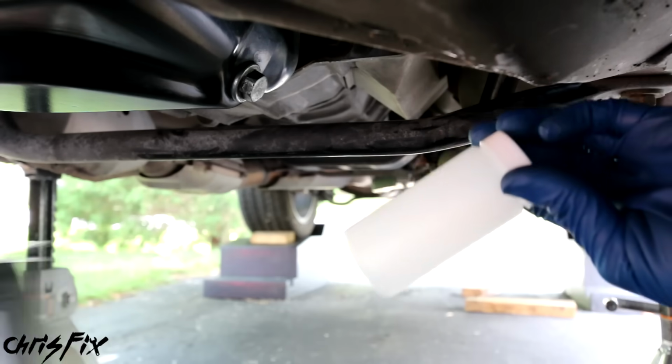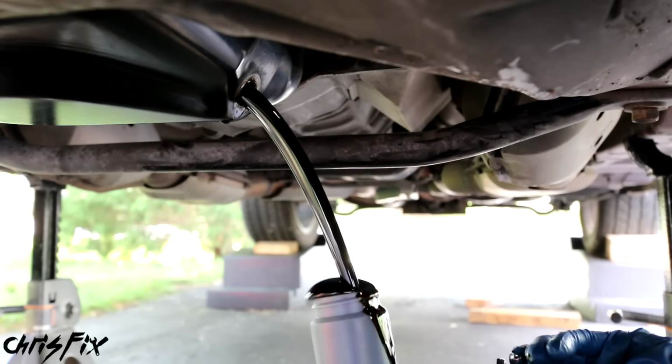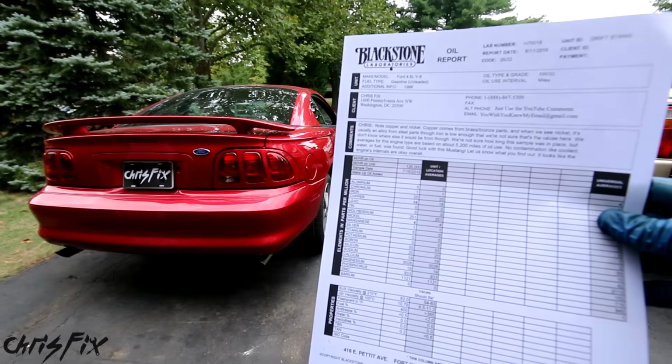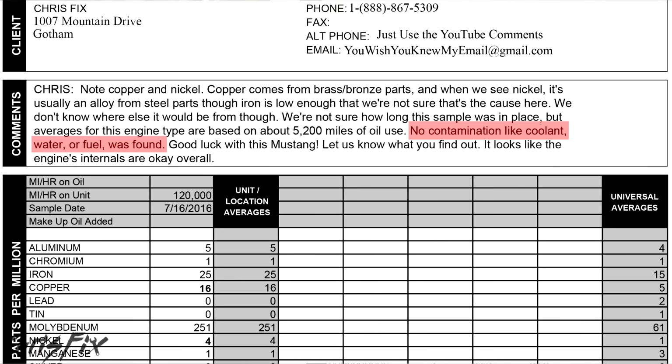If you remember when I first got the car, I took an oil sample because who knows how she was taken care of before me. This is a good way to find potential problems with your engine. It's like getting blood work done, but for your car. And well, I got the results back. I'll leave a copy of my results in the description for you to look at if you're interested. But Blackstone Labs said that there's no coolant or water in the oil, and there's no fuel in the oil. And everything came back so that overall the engine looks like it's in good shape. They even wished me luck.